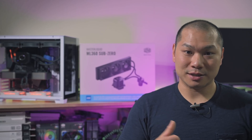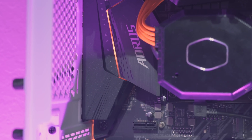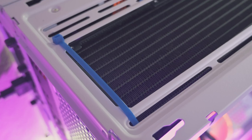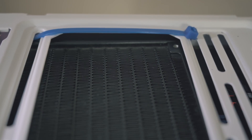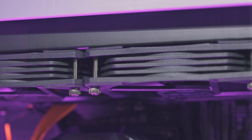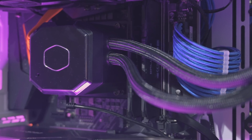I tried to mount it up first with the Gigabyte Z490 ITX AORUS board I had in this case before, but there was interference on the rubber shroud with some of the motherboard components, so I switched out the board to the ATX AORUS Elite. Though this board isn't listed as supported for the cooler, it does work just fine, and even the latest BIOS update mentioned support for Intel cryo overclocking. If you want to mount a 360mm RAD with this case and an ATX board, it will not fit on the rails, but it can be made to work with just some zip ties that you can actually conceal quite nicely. There is potential interference if you have tall or oddly shaped RAM, but with my Ballistix RAM there wasn't any issue. There is also a height limitation of about 45mm with the way these tubes are running with this AIO.